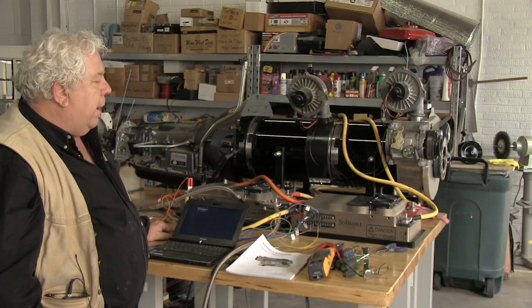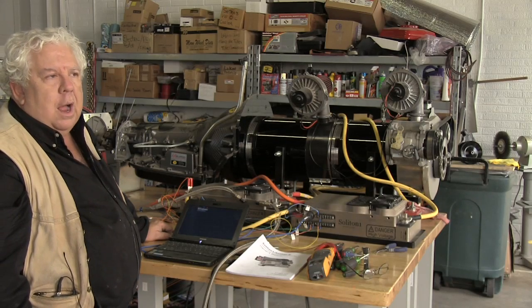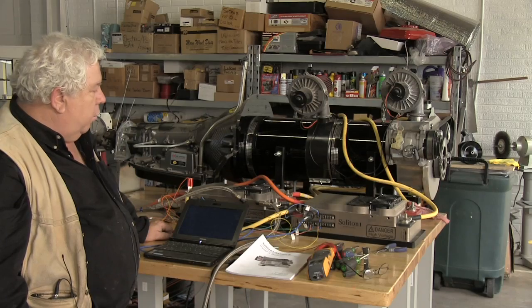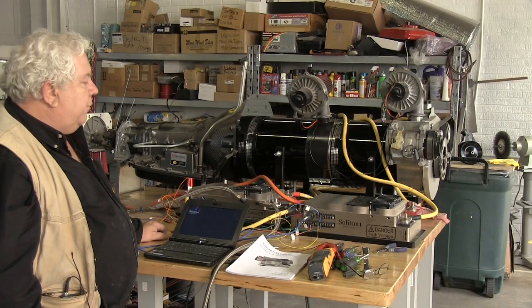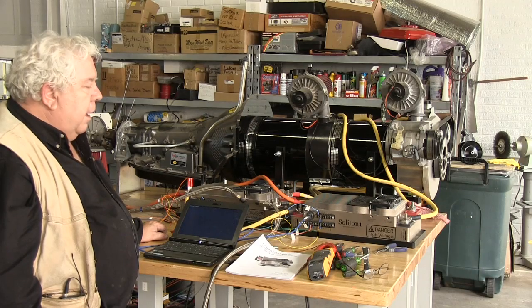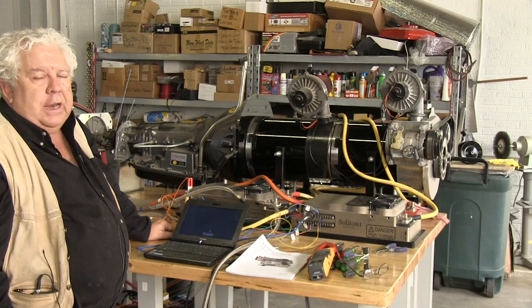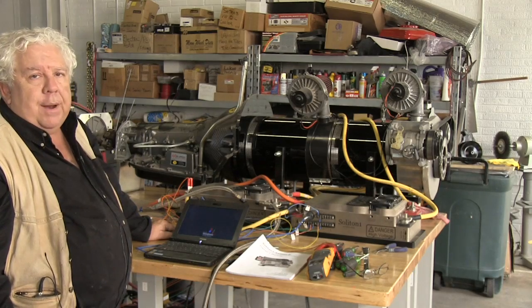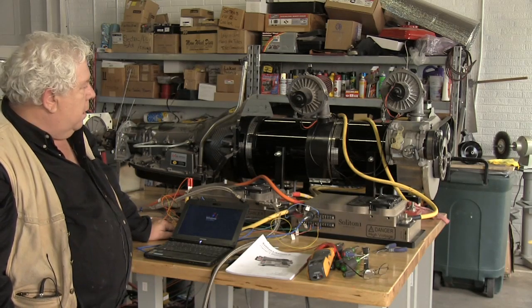I would predict these 400 amp hour cells may be slightly stiffer. There might just be a little gain on size to where I would hope to see 150 volts at 1,000 amps per motor. And with each of them putting out 1,000 amps, we're probably going to depress that voltage further from those cells. But the reason I think we're going to stay at 150 is we were working from 180 amp hour cells, and now we need two of those, or 360 amp hours, to maintain 147 volts, but we have 400 amp hour cells. So I'm hoping for 150 volts and 2,000 amps being what our batteries can deliver.